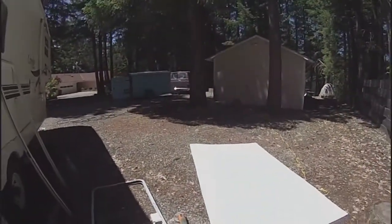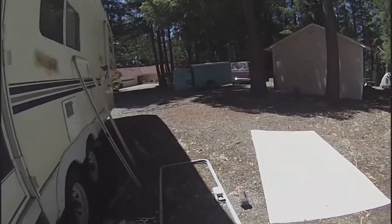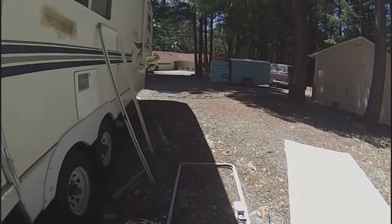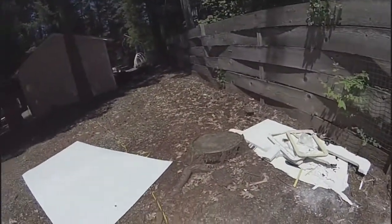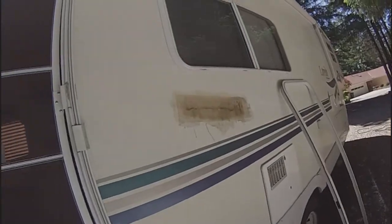We didn't realize the manufacturer of this particular door glued the door skin to the door insulation, which they're not supposed to do. It's only supposed to be glued to this metal framing. That way when you peel the door skin off when it's damaged, you're not damaging the insulation. Well, now we have to replace the insulation. So the owner has gone down to the hardware store to get a new piece of dense foam insulation.